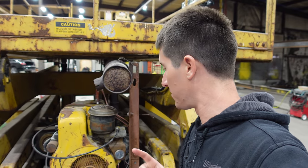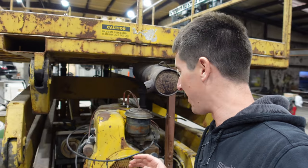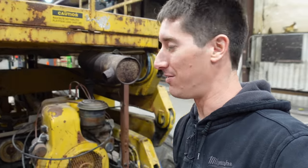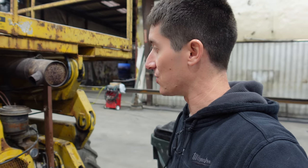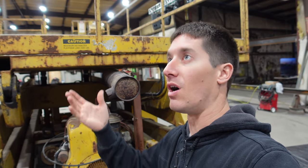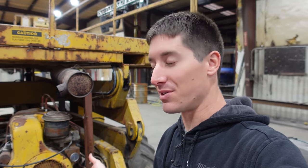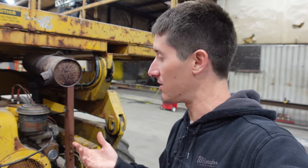It's been 15 minutes. Let's see if this thing will still turn after this. Let's let it cool off for just a minute here - it's nice and warm now, fully up to temp. I'm going to pull the spark plug wires, pull the plugs, and we'll compression test again - see if there are any changes. But I can tell you without a doubt - you've got to see it with your own eyes - zero smoke. Honestly, we couldn't even let this thing idle in here before because your eyes would start burning, and we'd have to keep the doors open. It's been running for the last 15 minutes and one bottle of stuff eliminated the smoke. Pretty crazy.